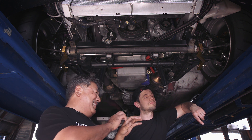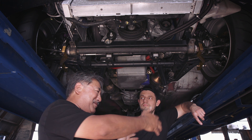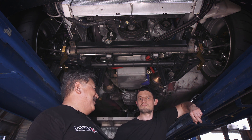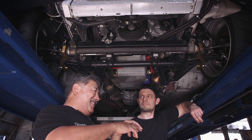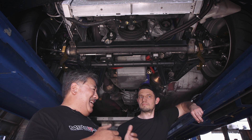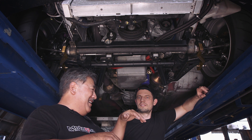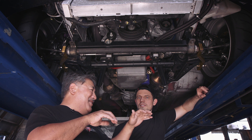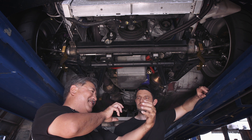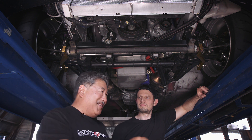So when the tire is pivoting, it's actually getting shoved in an arc rather than pivoting on its axis. When it's being shoved in an arc, the wheel is taking a big swing in the wheel well, so it will actually still rub and hit inside the wheel well. You're putting a tremendous load on the power steering, and you're actually shoving the tires differentially sideways — reducing grip so the car won't turn in very well. And then if you're braking on what we call split mu surfaces, where the friction is different on one side of the car — like if one wheel goes into a puddle — the big scrub radius creates a big lever arm to pull the wheel out of your hands or make the car squiggle around under braking.